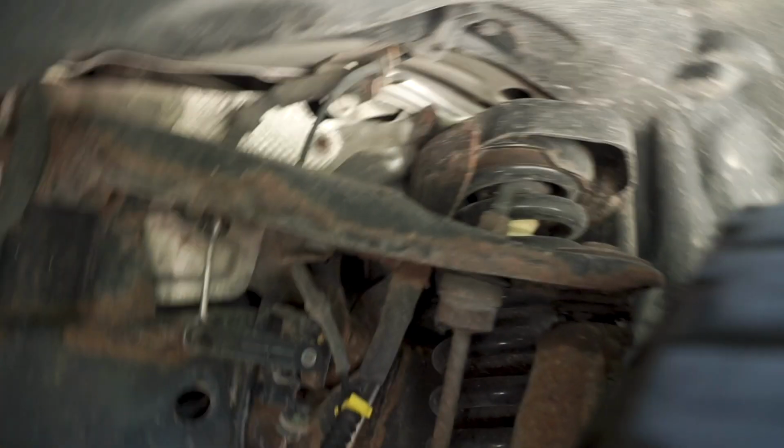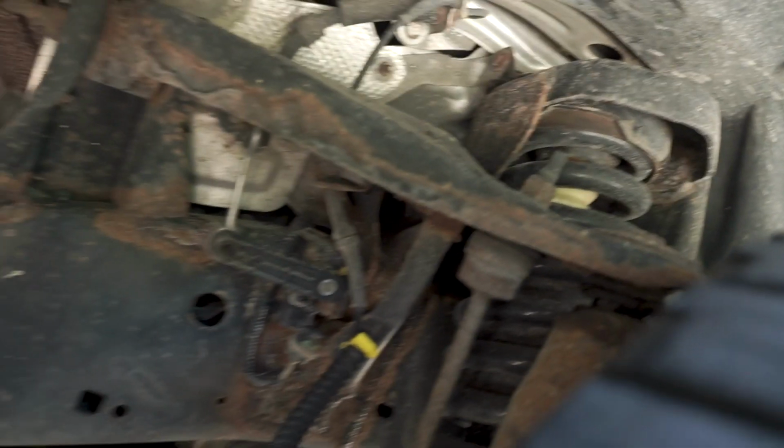As you can see up here, I do have the coil conversion. What that entails is removing all of the airbag struts out of the vehicle, disconnecting the sensors for each of those, and your lift rods. So if any of you are using Rhino rods, or maybe Johnson rods, or any of that stuff, you can totally just pull those out and sell them if you wanted to.